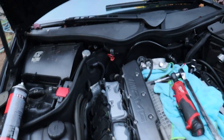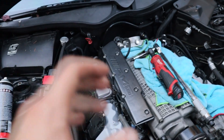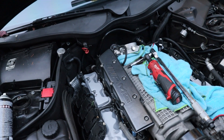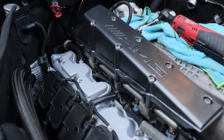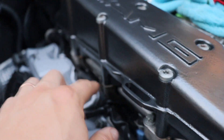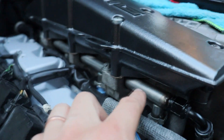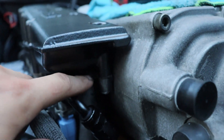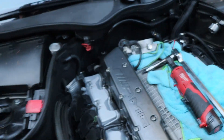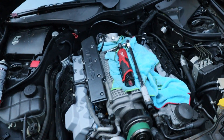We got one side of the surge tank on — sorry the GoPro was being glitchy as normal, but captured most of what we were doing. For the torque spec you really just have to be gentle with it, especially with the cork gaskets — go slow in small increments and you'll get there. We're clamped down at an even 10 foot-pounds for all of them. There's a little bit of blowout on the edges but those aren't sealing edges — from what I can see all of the seals are nicely tucked in and shouldn't be an issue.